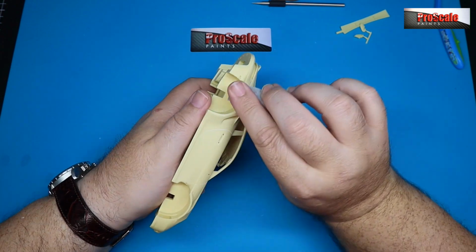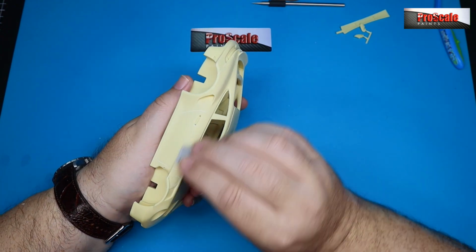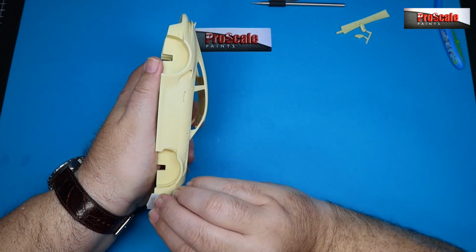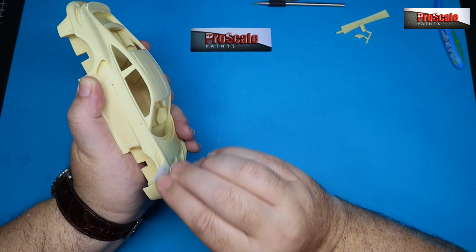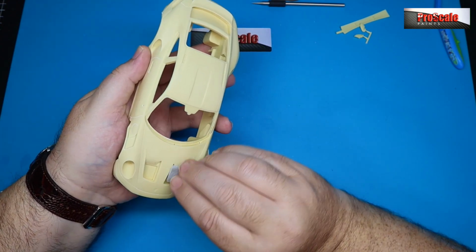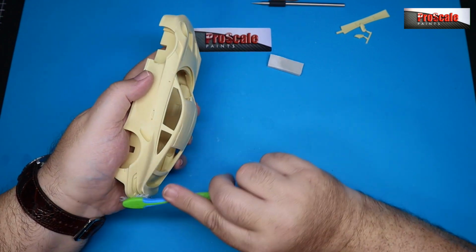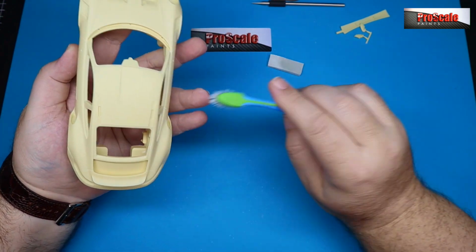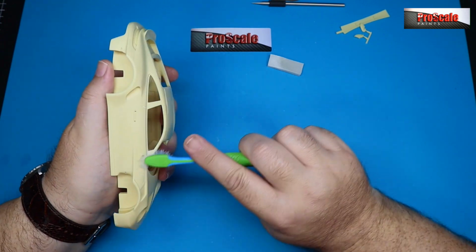And it will key the surface for our primer, so it'll put thousands of micro abrasions in the surface, and it will allow our primer to adhere better. That's the theory behind it. Real full-size body shops use this theory, so I'm going with it too. Again, once we've gone round and scuffed it all up, we're going to go around with our toothbrush and again clear all the panel lines of any muck or dust that might be in there.